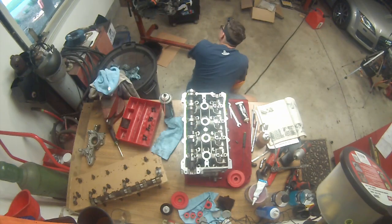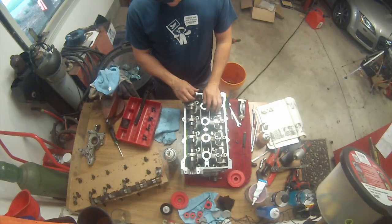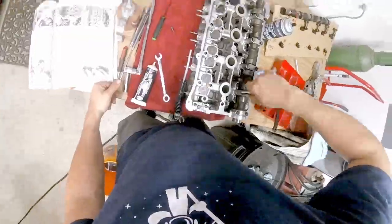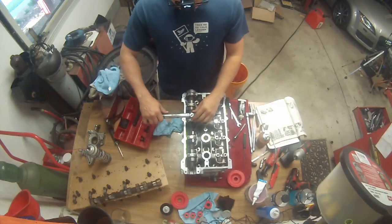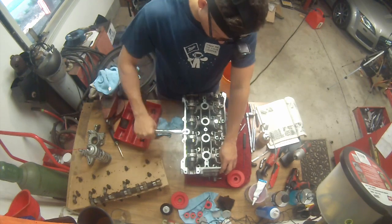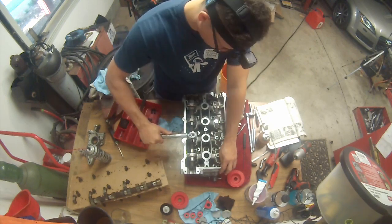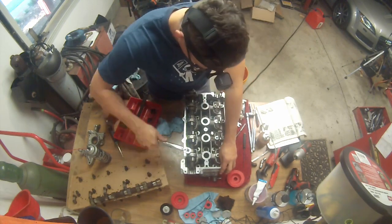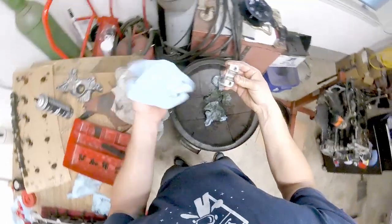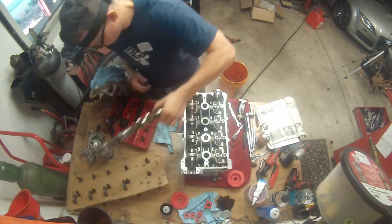Remember, we're just putting everything on hand tight for now. I use a quarter inch ratchet before the torque wrench just to get everything hand tight, and then I'll chase everything with the torque wrench. Note the pattern here of torquing everything down: you do the inside cap first, then the two on either side, and then the two furthest out from that. You must go in order or you risk cracking your cam caps. The process is exactly the same for the intake side — wash, rinse, repeat all the cam caps. Use a little glue on that first cap and be sure to use assembly lube throughout.